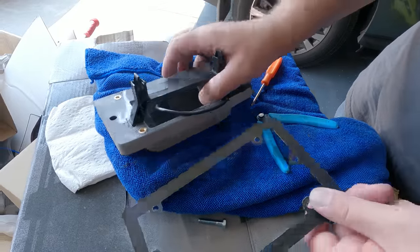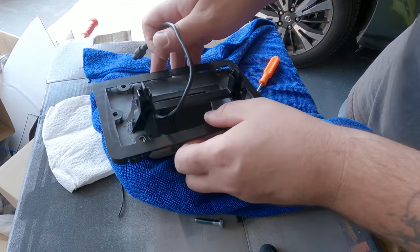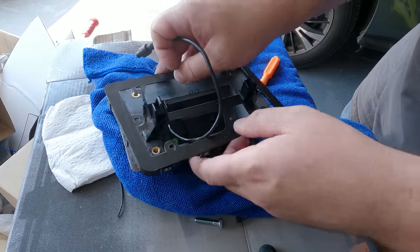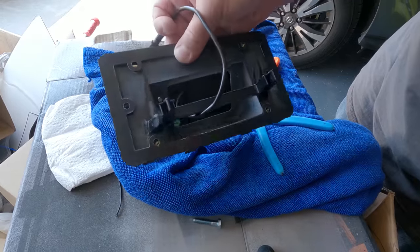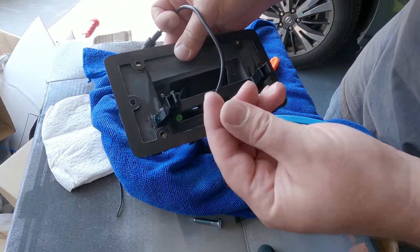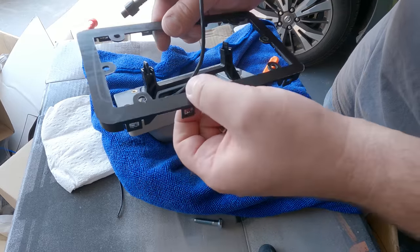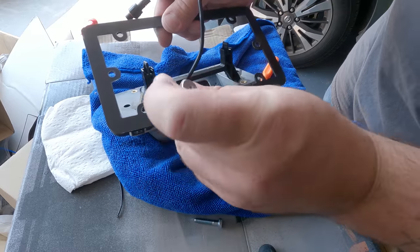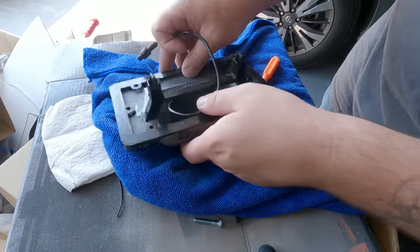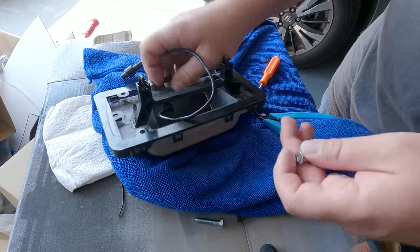We got the Aux Beam unit installed. All I've got to do now is mount this bracket to mount it up in the overhead trim panel. I did these brass inserts as quarter-20 just because I had them on hand, but I forgot to go get quarter-20 hardware so I have these tapered head screws that'll just have to work for now. This bracket is a little thinner and flimsier than I'd like, so I'll probably thicken it up and maybe do a countersink to flush those screws. I might switch out to thinner hardware in the future.